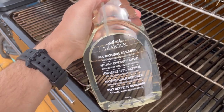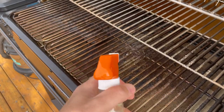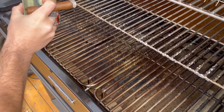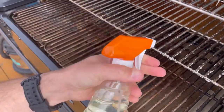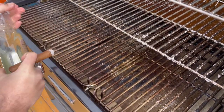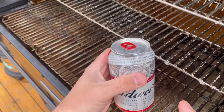First things first, we're going to spray it down with that cleaner. I spray it quite heavily all over the place. It's all stainless on the inside. This is a natural cleaner, so you don't have to worry about it — it's not abrasive, it's fantastic stuff. I do honestly prefer this Traeger cleaner. We'll spray it on there and let that soak for at least five minutes. I did the whole thing from the drip tray to the back to the grates, all of them.